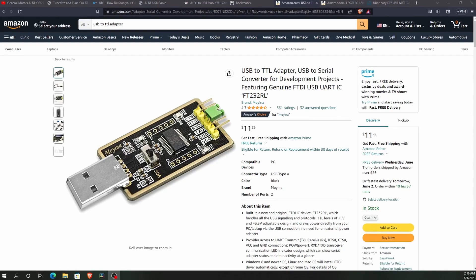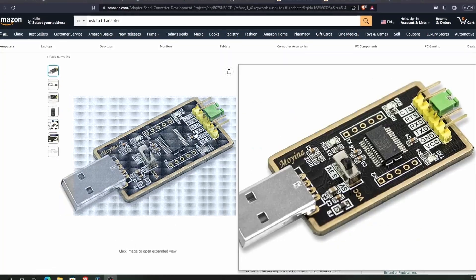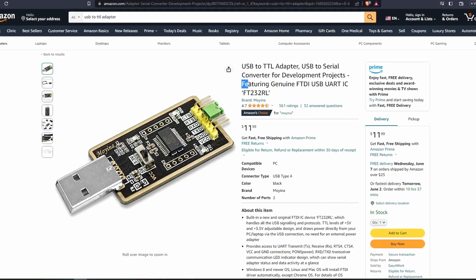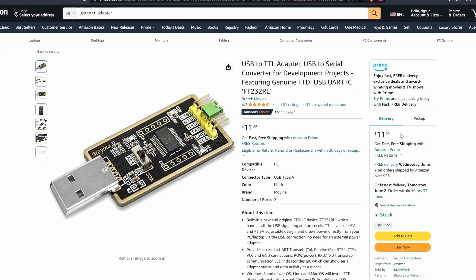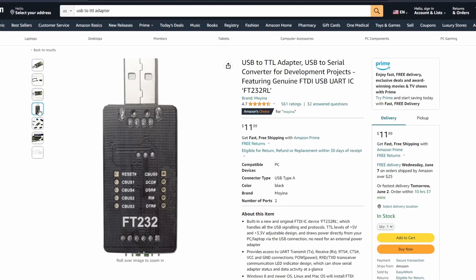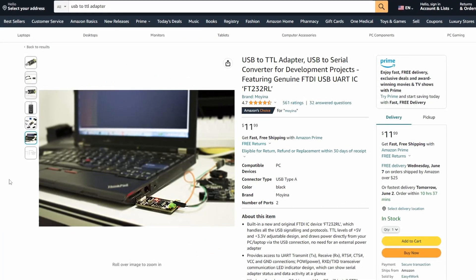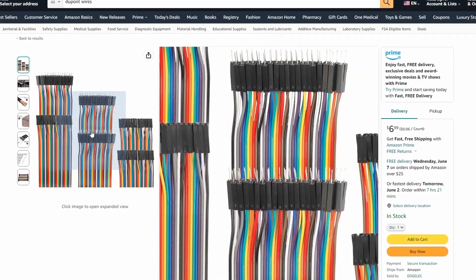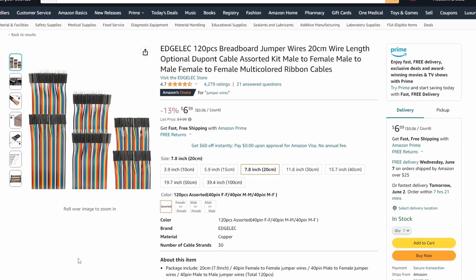What you want to do is find yourself a TTL adapter and some wire. You've got the laptop, and all you're going to need is a USB to TTL adapter — and you're going to want a genuine one from FTDI International. There's a bunch of rip-off ones and you can get these things pretty cheap, but this is a genuine FTDI and you can use these to program and talk to other things. It's a nice tool to have. You don't really need the wires I'm about to show you, but they're very cheap — $6 — and they'll plug right into that. There's ones that would actually fit in your OBD1 port. I picked them up. 120 pieces, rainbow colored — beautiful.